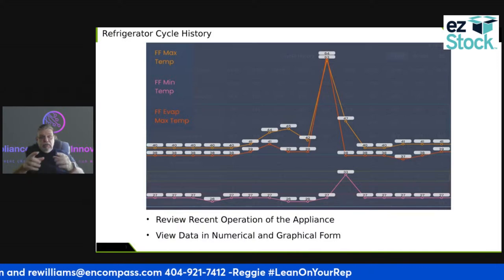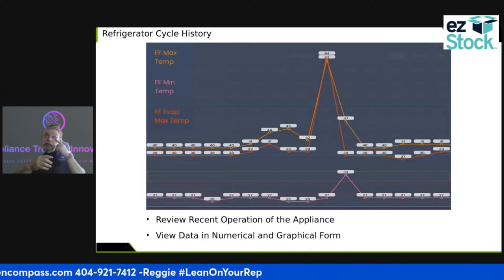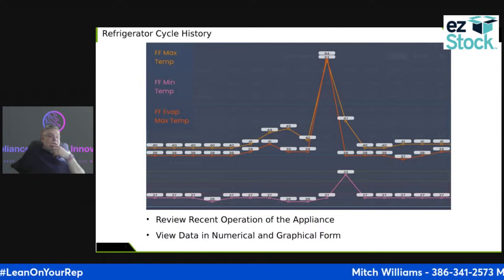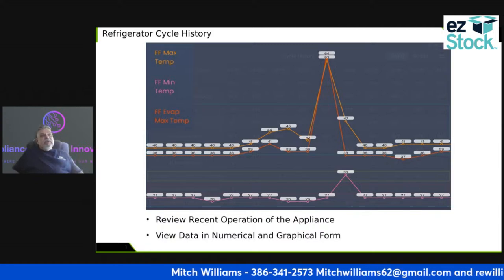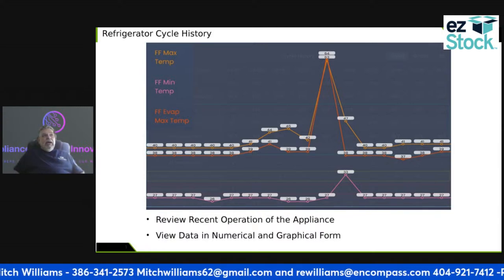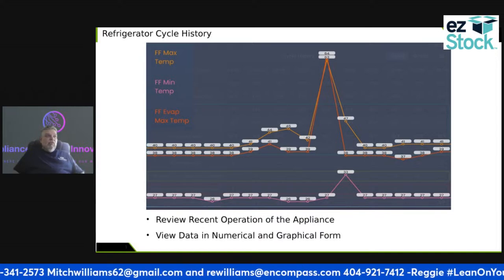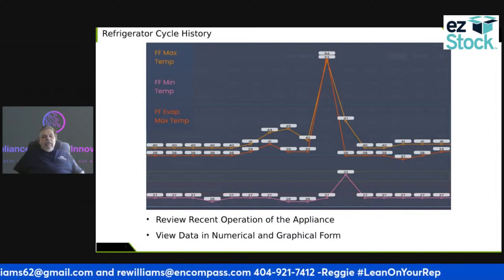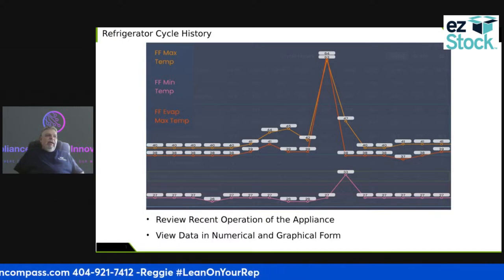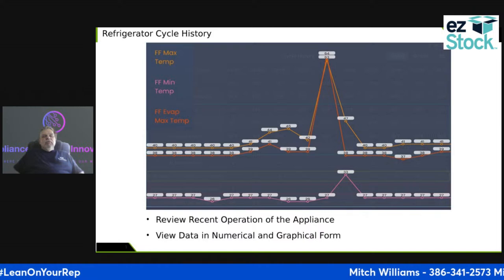and I go through and look at this chart, it says, hey, yep, the thermistor's probably bad because this is what the thermistor's reading. I can check my thermistor looking back at the other slide that I showed you. I can see at 32 degrees what the thermistor should have been reading. I can go to it right now and tell myself exactly what that thermistor will be able to read during that slide.